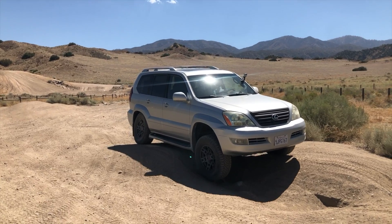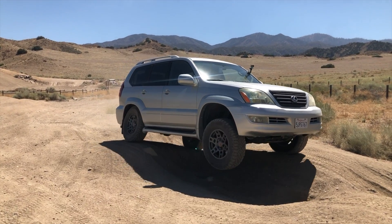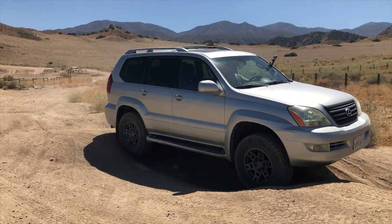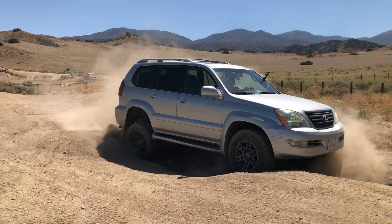A rear locking differential — do you need one? Yes, you do. I also need one. I got pretty far without one, thanks in part to Toyota's A-Track, which is a pretty great low-speed traction control that transfers power from the slippy wheels to the grippy wheels. But I've encountered enough situations where the grippy is still too slippy and I either have to turn around or spend two hours digging myself out, so it's time for a locker.